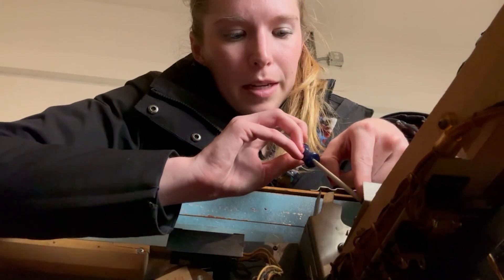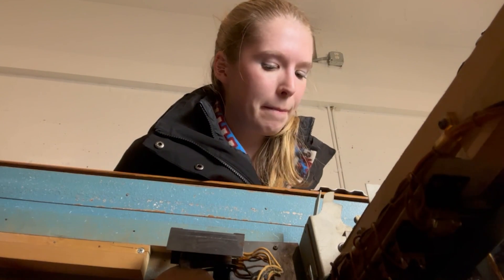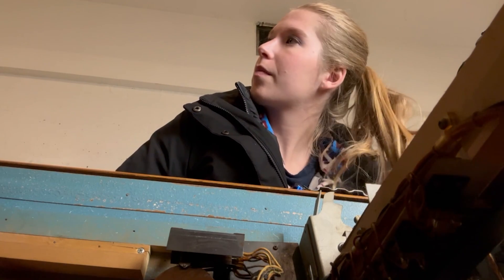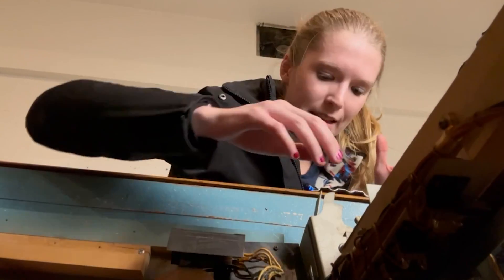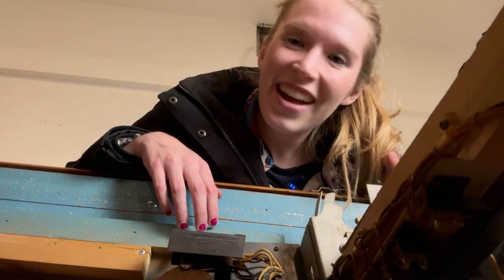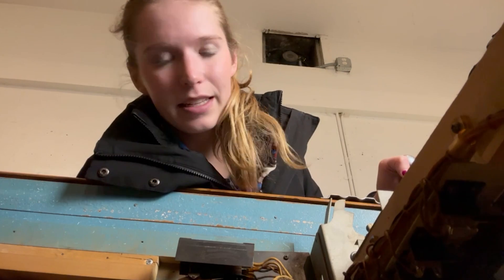In my pursuit to fix things, I broke things — which happens sometimes, but it does suck. Something is happening with the ball lifter mechanism. After turning it on again, it loaded and we reset it. My guess as to what fixed it? Magic. My second guess is that I was touching some of these switches, which tell the machine how many balls are in the ball trough, and perhaps in my touching and prodding of them, I knocked some debris loose or bent something a little bit better. Something magical happened, but it seems to work now, so let's try playing a game again.